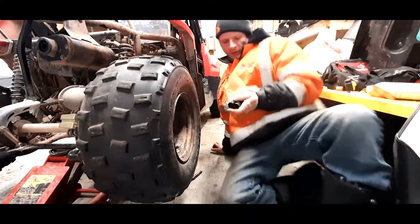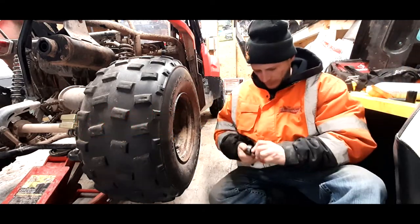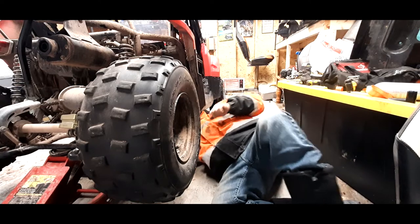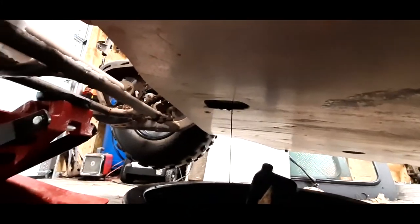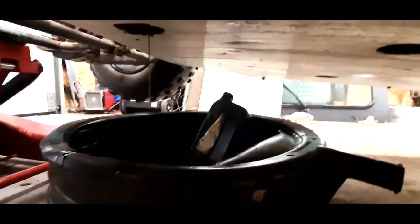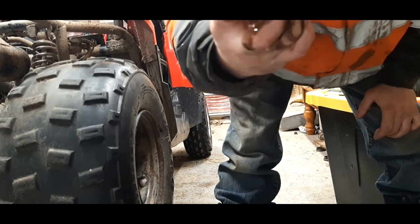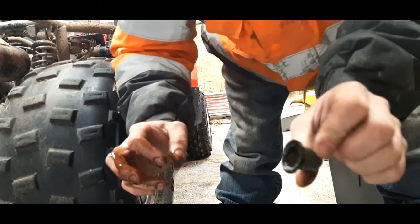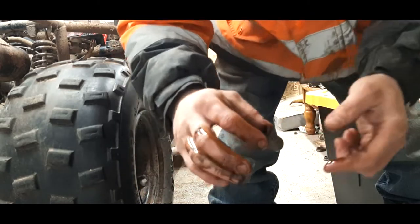Back it down here. The size of the drain bolt on here I found is 17 millimeter. Socket here. Some pretty old looking stuff. There we go. Here's the screen filter that they use. You just gotta clean that out and put that back in. She was all stuck in there. Nothing big, nothing major.